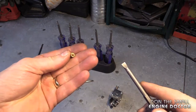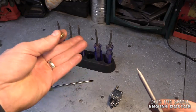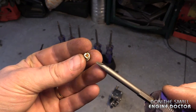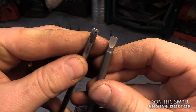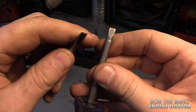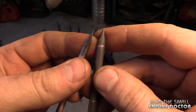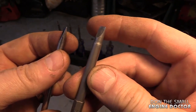And there's the jet — you can see these screwdrivers fit perfectly in these little jets. Now you might be wondering: do you really need a special set of screwdrivers to remove jets from carburetors? Well, you don't, but it's better to have these because there's less chance of damaging your jets. The reason for that is the tip of the screwdriver itself, and also the shaft.